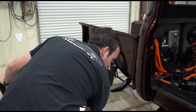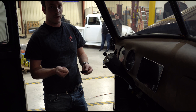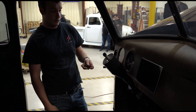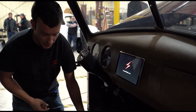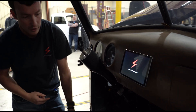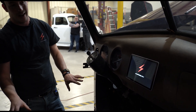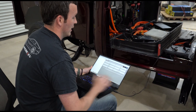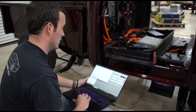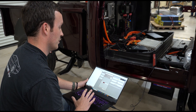We're going to key on the vehicle — this one's a bit unique with its aftermarket key fob system, but in some cars you might just be turning an ignition switch. That's going to let us connect up with the laptop and start going through our sensor check. You'll see that our GUI turns on. A lot of the shifter lights and stuff will become active, but the car is not going to have high voltage active yet at this point. We have our cable connected, and we're going to open a display file and select the display file for our software version that's on the car.